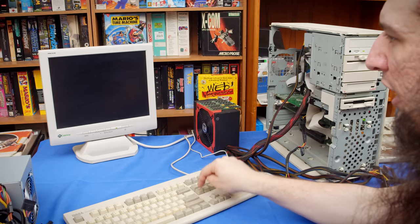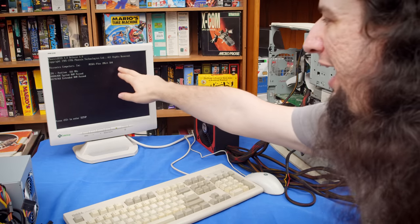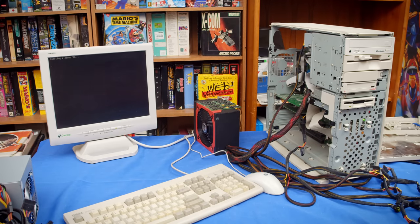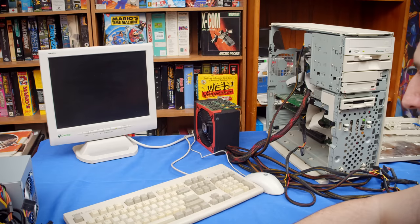Well, let's look at the BIOS, let's see if there's any version information listed. A little extra scary that this thing may have had a BIOS update attempt. So we're at S04, BIOS update attempt with bad RAM installed. So I've got the Retro Web, formerly Ultimate Retro, up on one of my computers here because I was looking at this thing, trying to figure out maybe there's like a voltage configuration issue on the motherboard, because that's what gave me so many errors with the Tiny Pentium for years. So I was wondering if maybe it could have been that, but no, clearly RAM, since yoink and all that immediately solved the problem. So I didn't pay attention to how much we have now, but yeah, it seems to be working much better. Let's actually pay attention this time.